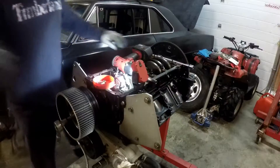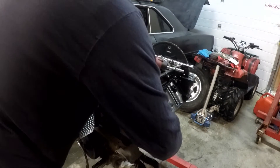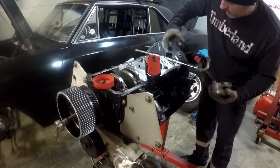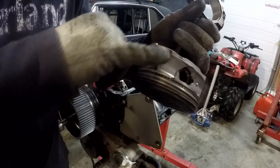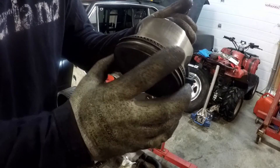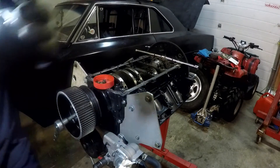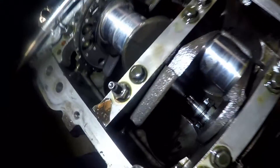There's a little bit of coating that's flaked off on the skirts on one of them, but it's not too bad. The rings are still intact — they almost look shiny on the ends. I'll take them off and inspect them to see if they've actually worn over, or if they're just on the edge. And there's the guts of the engine.